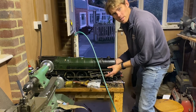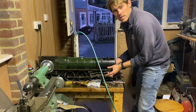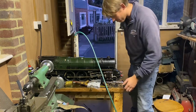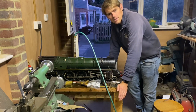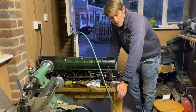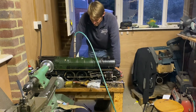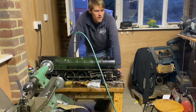I am now convinced that it is blowing past the liners. I need to take the liners out and look at how they're sealing inside the block. Only once I've done that and resealed the liners can I think about the pistons and valves. I'm saying the liners are passing, but I may end up destroying them taking them out, so it may be a case of needing new liners.